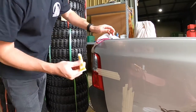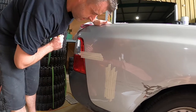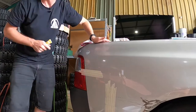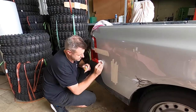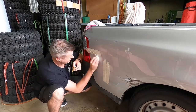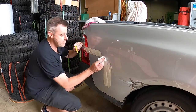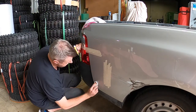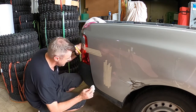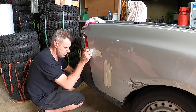So this is the actual scratch remover. I'm hoping with this it's going to remove all the marks that the 3000 grit has just put in the paint, so we'll go to a time-lapse and give all this a hand polish. That was about a minute of hand polishing and it's pretty much — in fact I'd say it has completely removed all of the wet sanding marks that were in there. Which is pretty impressive.